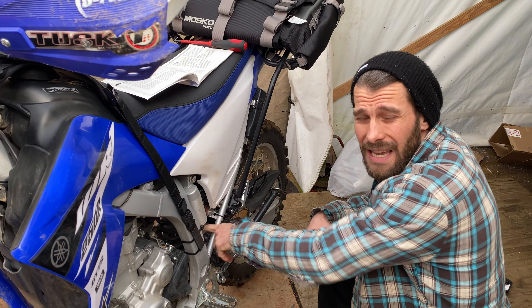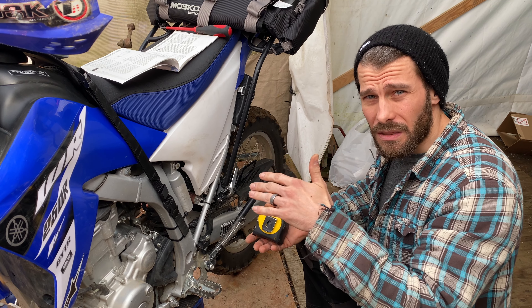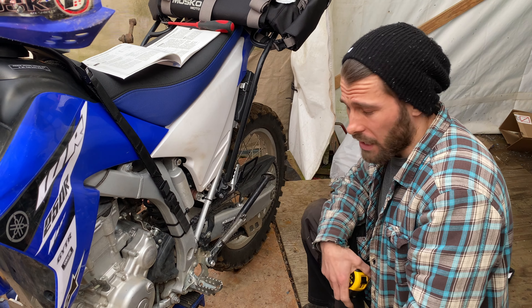Now I've got to measure the spring to see how much it's compressed. We want it to be eight and a half inches for minimum softness as the manual suggests — it's right at eight inches, so half an inch worth of adjustment needed. Using my trusty tools to loosen the first jam nut so I can move the second jam nut and adjust the spring up another half an inch. The spring moves ever so slightly with each tap — it would probably be easier with an actual spring adjustment tool, but you use what you've got. This one requires a bit more patience than the front.